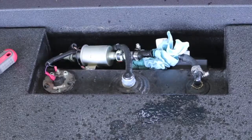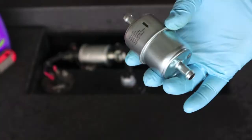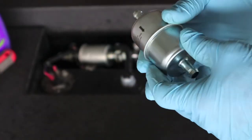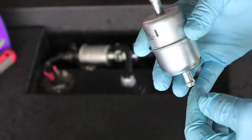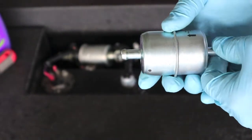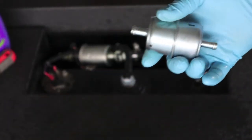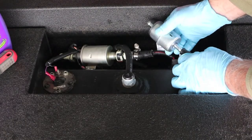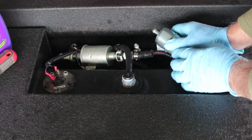I spilled some anyway, it'll clean up. It's a Wix but it's made in China — it's all metal though, and I think that's what's important on an external fuel tank or one inside the bed of your truck. We have an arrow where the flow is; the pump's pulling it, she's flowing that way. I think we'll put it in this way first. Nice snug fit.